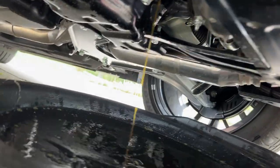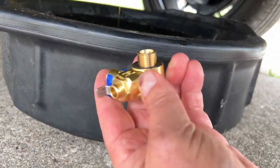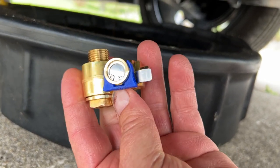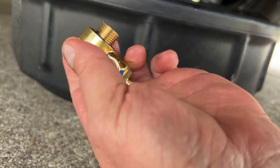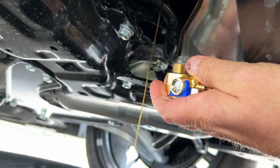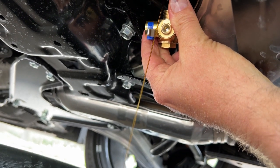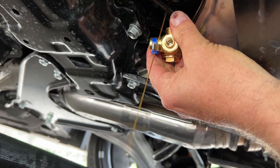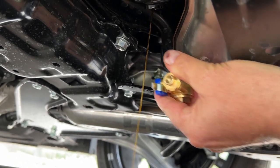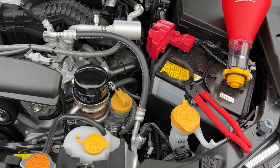Go ahead and put this under here — it's still draining. Warm the engine up for a few minutes first. With the Fumoto you can position it any way you want. There's a bolt that goes through there so you can swing it around to any final position, then torque it down to 18 foot-pounds. It's going to go right up in here at a little bit of an angle. It's well up under the car — definitely clearing the bottom so nothing will snag onto it. Letting the oil drain out of the oil pan now.